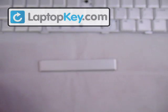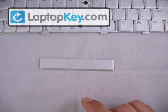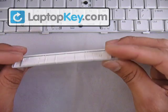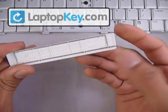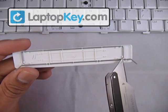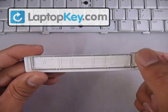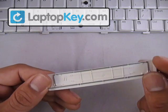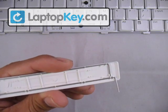You can see at the top there is a flat square cut, and at the bottom it's angled — that's how you know the position for it. Don't flip it over this way to work on it; flip it over this way and you'll see the position for the wires. At the very top you have to place the small wire and make sure to click it at the tips, here and here and along the whole top area. Then for the large metal wire, that also clicks along the very bottom fittings on the keycap — so all fittings are at the bottom, none at the top, because you want to open your wire and flip it over again.